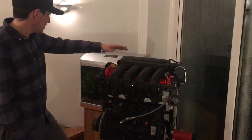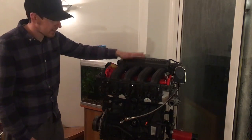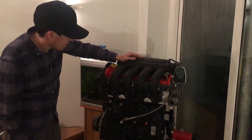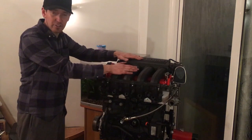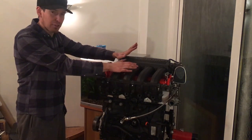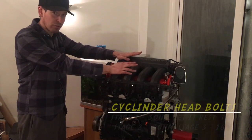I've got the turbo on the back, but most of the little hard work is done. Cylinder head goes on of course, and the torque settings for that is 30 newton metres and then 180 degrees.